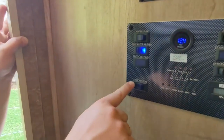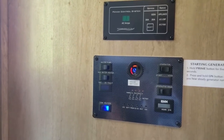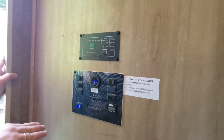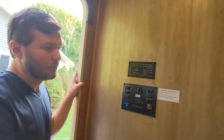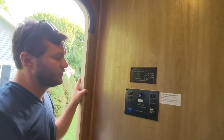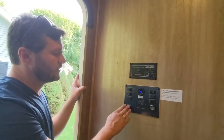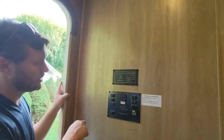The tank heaters button is specifically for winter camping. When turned on it heats all the tanks underneath as frost prevention. This unit is winter-ready — it won't handle extreme single-digit temperatures, but if you're in the low 30s to high 20s, turning this on will prevent tanks and piping from freezing.